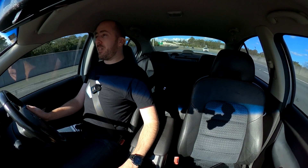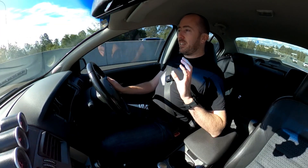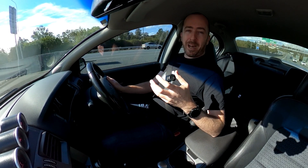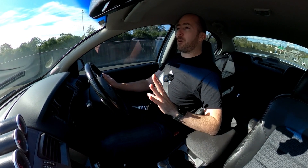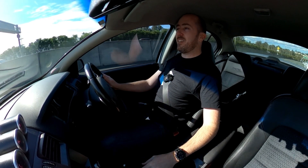So I think it purely comes down to the balance, unfortunately, and that's something I can't do myself. Having said that, I did try and troubleshoot it by unbolting the tail shaft from the diff again. I spun it around until the old markings lined up, then bolted it together again — and this was the test drive for that. It hasn't made a lick of difference. I guess that makes sense because the tail shaft is balanced, so in theory it shouldn't matter which way you bolt it up.